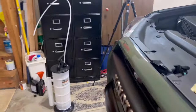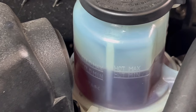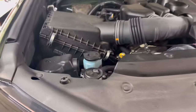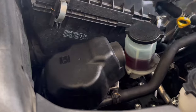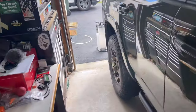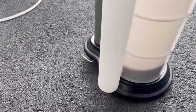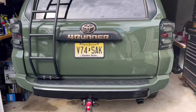So let's check the level — it might be a little lower, but as you can see, let's zoom in. We're actually looking good. It's a little overfilled, but what you want to do now is take the car for a drive, bring it back in, and check your level. Now that I just got back from the test drive, let's take a look again at the fluid. Would you look at that — that is perfect. As you can see, it's nice and bright and red as it should be. I'm going to give you guys a sample of the old versus new so you can see the contrast. This is all I got out — it's not a whole lot, and you get the job done at home. You too can do a power steering flush, absolutely no problem.